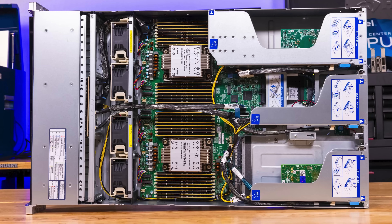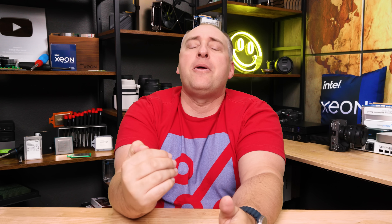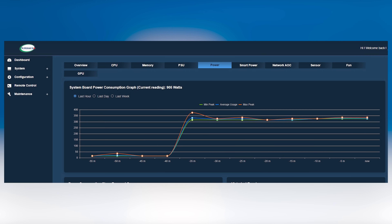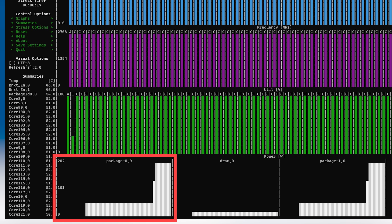We had the QCT development system and also the Supermicro system. We didn't get to do our full power testing, but to give some idea: we ran the 330-watt TDP 144-core 3 GHz parts at maximum using StressNG. Package power went from about 75 watts per CPU up to the 320-330W range. Overall server power just barely topped 900 watts. With the 6766E 2.7 GHz 250W parts, we saved 80 watts per CPU — 160 watts total — putting us in the mid-700W range for 288 cores in a system.